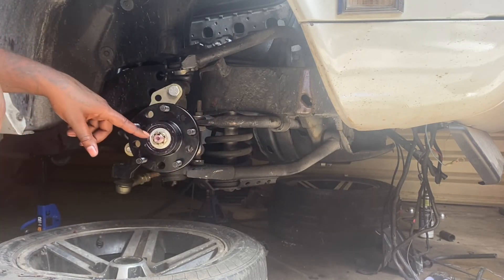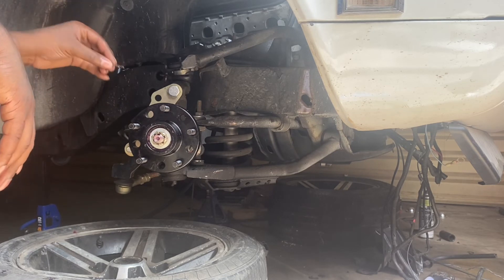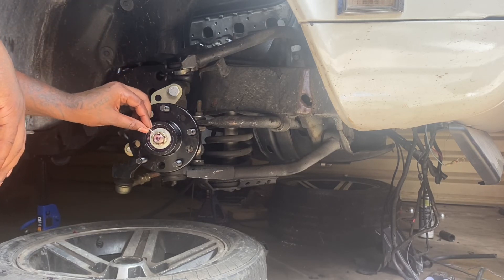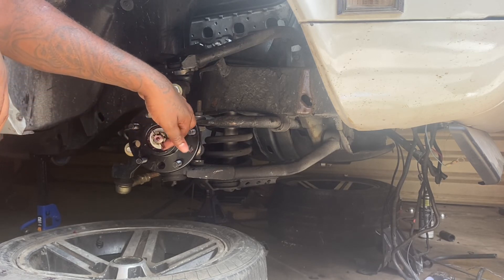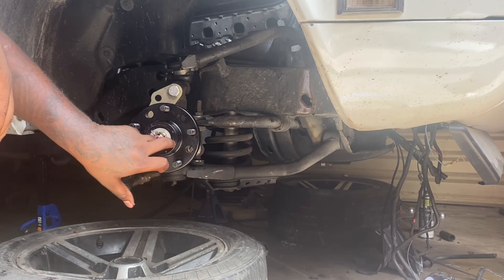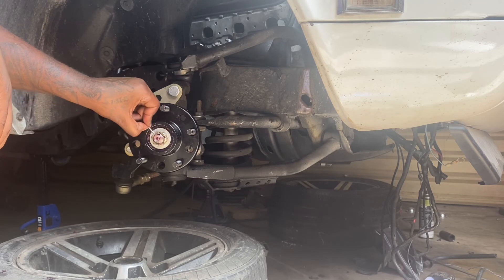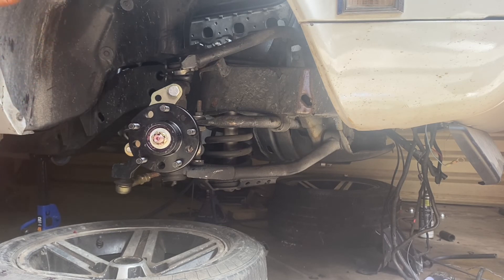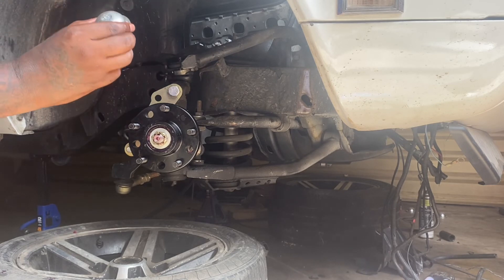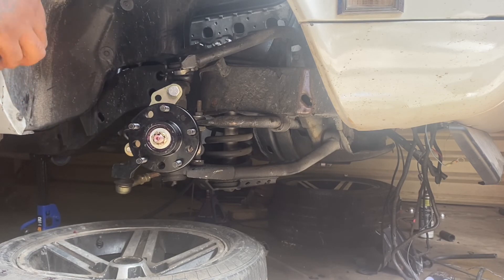While you're turning, there's going to be a little hole that sits in the side — through that hole you have to drop this pin through. See, the pin goes all the way through. Peel this side back — you just need some needle nose pliers to peel it back or peel it forward to lock it in place. Mine is not getting locked in place right now because these have to come off — I have to undercoat the inside of my wheel well. There's also a silver cap that goes over the front of this that comes in the kit as well — that also goes on once you're setting everything permanently.